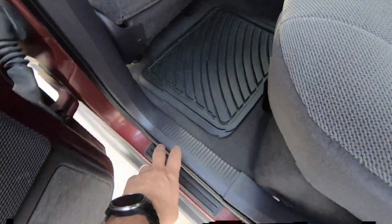Now what we've got to do is get access behind here to connect this red cable to the violet and black cable that is for the backup light. It's really windy out here. To get this panel off we've got to take this panel here off, and to get this one off we've got to take the top one off, which we've got to take off anyway to gain access. Before we get this back piece off, we've got to take this tonneau cover off. Let's go ahead and pop the tonneau off — just push it together like so.